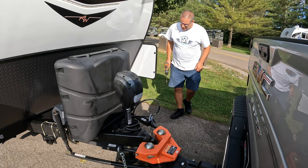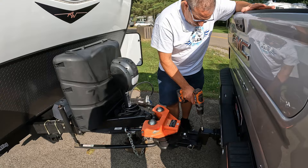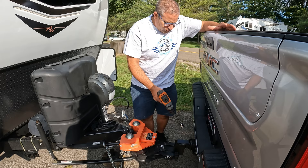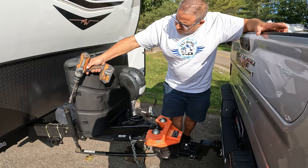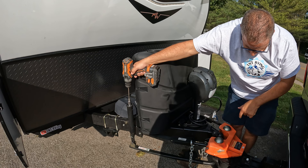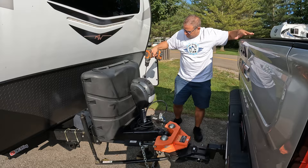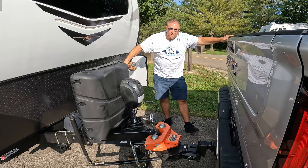So the spring bars now are going to need to be loosened up. If you didn't loosen up the spring bars, you're gonna have all sorts of torque applied to the hitch and you'll never be able to find where it's loose and easy to remove the stinger. So after we have our jack stand on the block, we're gonna loosen up these spring bars on either side. You'll see the torque and lift and the truck will move. So that's loose, especially when I loosen up this side - you see how the truck moves. Now the bars are nice and loose.